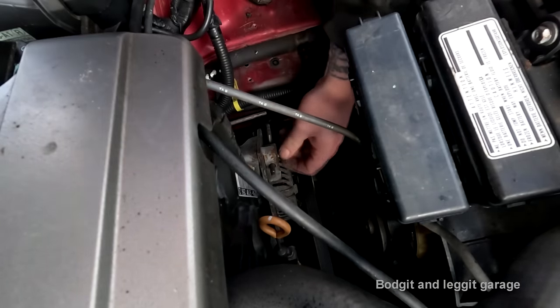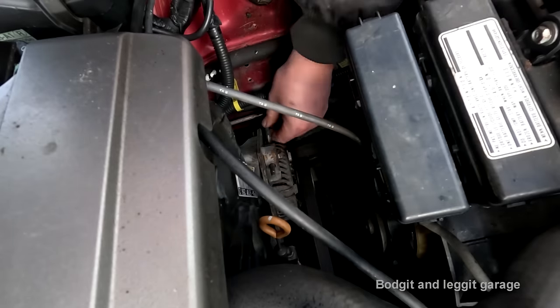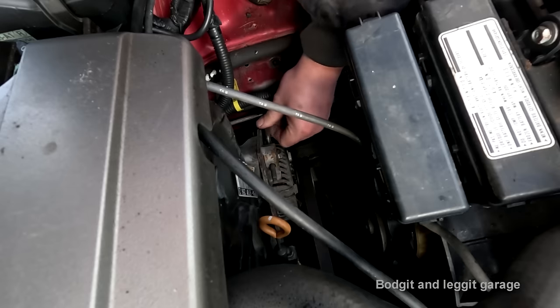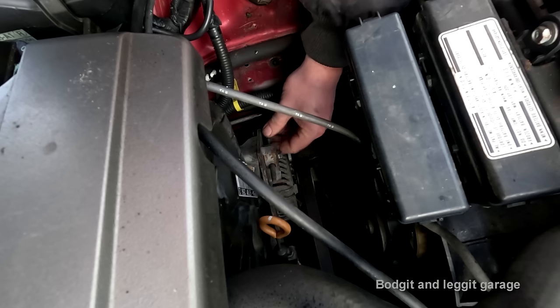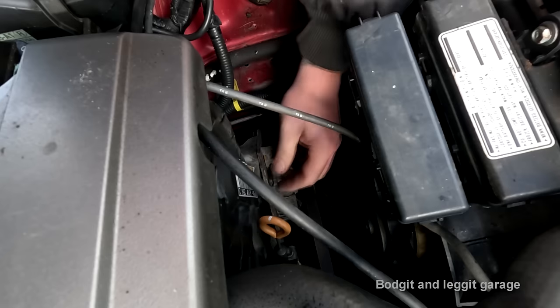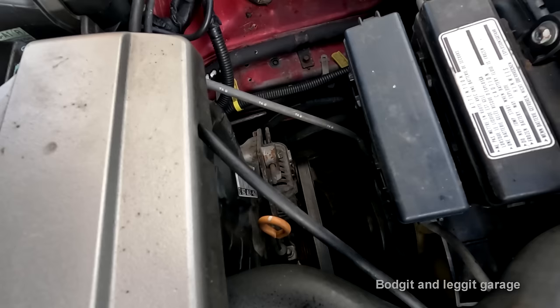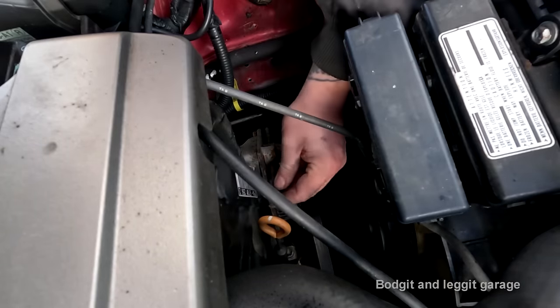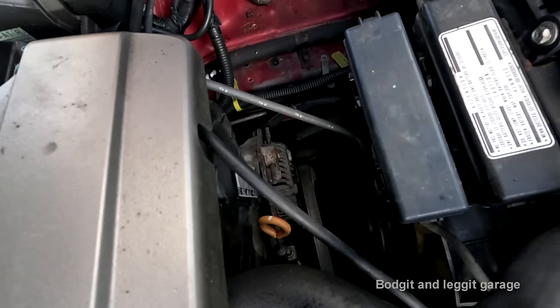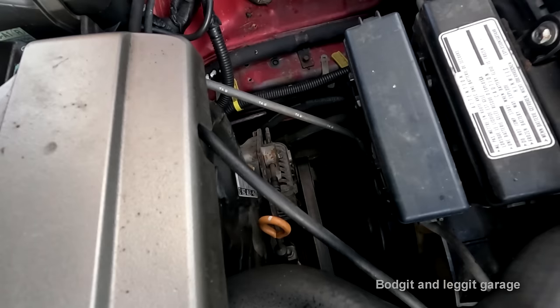Right, so that is now on. So what I've got to do again, I won't tighten that fully, but now when I do this, this will be tensioning the fan belt. See the alternator moving? Now what I've got to do is do it with something. Hopefully one of my sockets will fit. It should do it. What size are we looking at? It's 5.5. Well, maybe 6mm. Yay! That makes things a little bit easier.